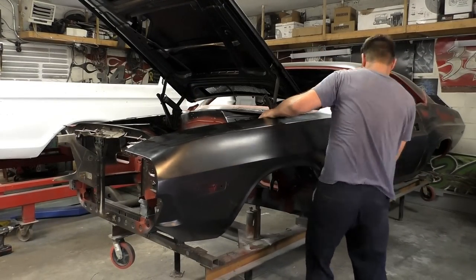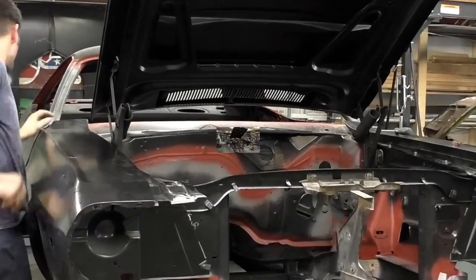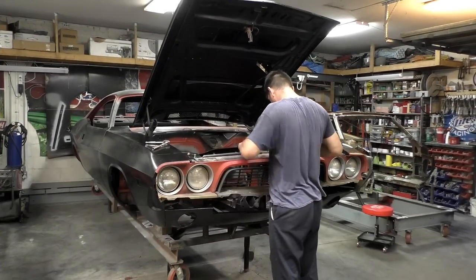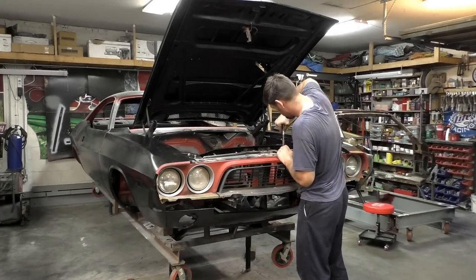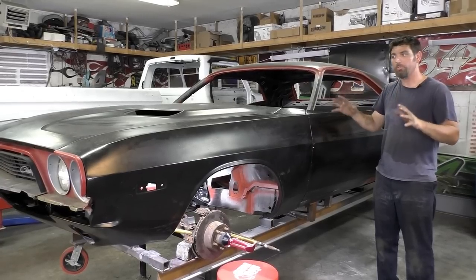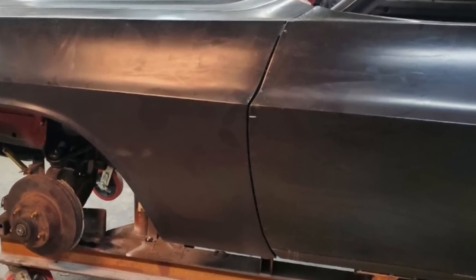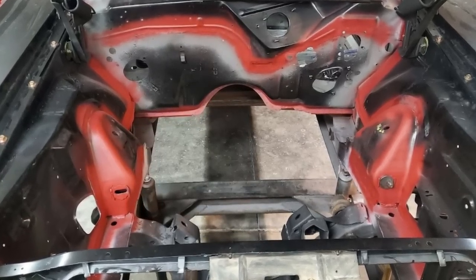Coming down to the home stretch - we're going to put the fenders on the car. One thing to point out: there's a bracket inside the fender in the rear that is going to hit the US Car Tool side braces, so you'll need to make a small cut - about two to three minutes once you trace it out. Be prepared for that and don't crank on your fenders or you might end up bending them. We're going to finalize this car by installing the front grille - it still needs work and we'll get to that in a future part. Wrapping up, we got all the panels on both sides of the car, everything's pretty much bolted on, somewhat adjusted. Most of the gaps are around 3/16 - that's where all the panels came as stamped from AMD and Dynacorn. All in all, the car looks really good and I'm really happy with the engine bay and how the welding went.